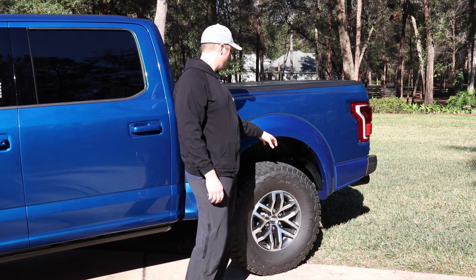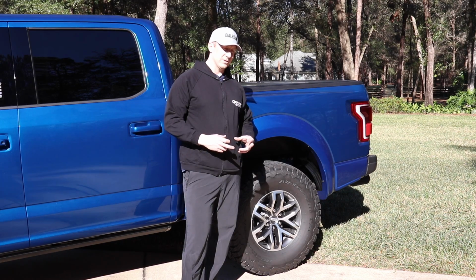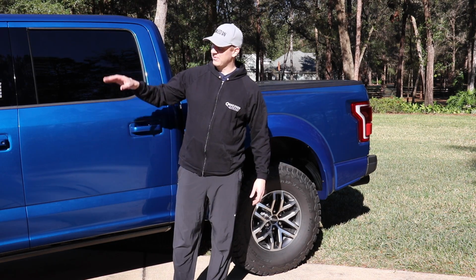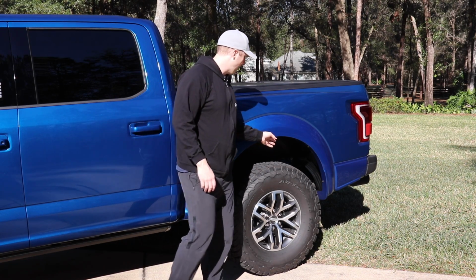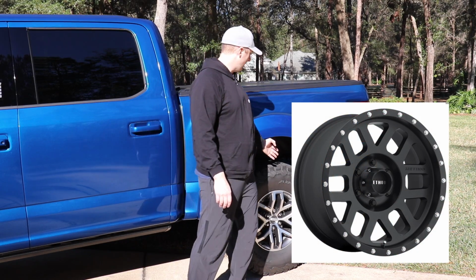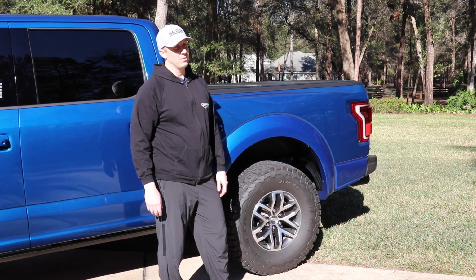On the Gen 1, you'll be able to see this probably a slight bit more because, depending on, I think I'll do 3-inch Deavers, get rid of the block, and so I think it ends up being about 3/4 of an inch higher than it is now. I don't want to lift the truck, and then what we'll have to do is we'll probably have to raise the front up about an inch to level it, so we have a nice level stance. And again, we'll have a slightly more aggressive offset with the Method. I think I'm doing the Method Mesh 306, which will be an 18mm offset. And I'll be going to a 325 from a 315, which would make it look a little wider.